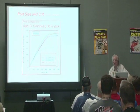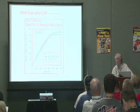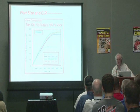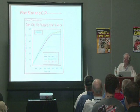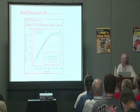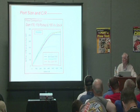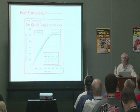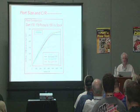That velocity is so high — if you allow it to be high by not oversizing the port — it can generate about seven pounds of positive pressure at the end of the piston's induction stroke. The energy in the port is equal to half mv squared: that's half the mass times the velocity squared. So if you make the port 10% too big, you have just killed 22% of the energy in that port.